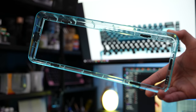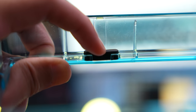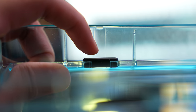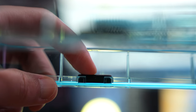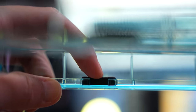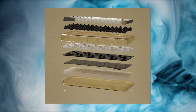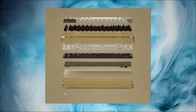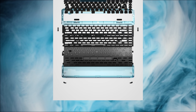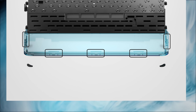If we look at the top shell, we see the friction-fitted gaskets, which are a squishy rubbery material at about 6mm thick — so it's an interesting implementation of the gasket mount idea. The top gaskets have a range of movement to them, but since they're on the top side, they won't impact too much with the bottom out. Instead it's the middle foam layer that kind of does it, but there's not a whole lot of compression in that. They do try to implement a kind of tab design with the raised bits in the wall, but it's still pretty much along the whole perimeter, so pressure is more evenly applied and we lose that potential flexibility — ending up with a dampened but still kind of stiff experience.